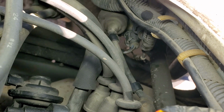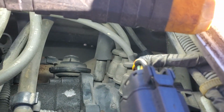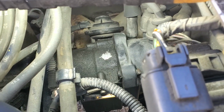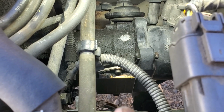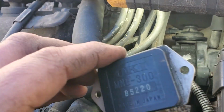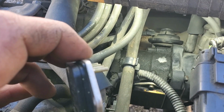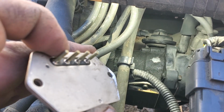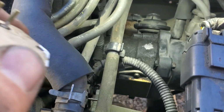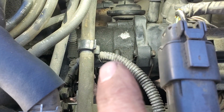I don't know if you can see them or not, but that's one right there beside the coil wire. Unplug that, and it's another one on there right beside it. When you take that coil distributor off, excuse me, you take them two screws right there out, and you pull this little plate here off. This little plate here, I just took a little screwdriver and pried it off, and had a little grease, and it's a little rubber piece that goes around here to keep oil and water and dirt and mess from getting out of there. And you put that back on there, and it's got a slot in there.